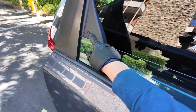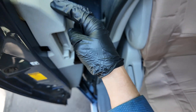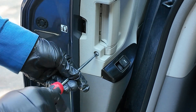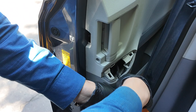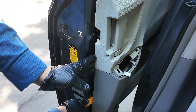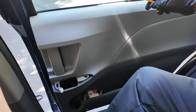The window is down, then I need to remove this thing and remove the screw bolt locking down the door. I need to remove this plastic cover when I slide the door, closing it down, and disconnect it. There are felt-back loops — close the door to have access to the full panel.